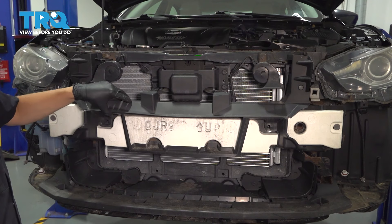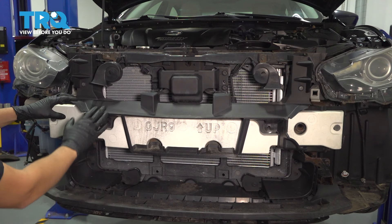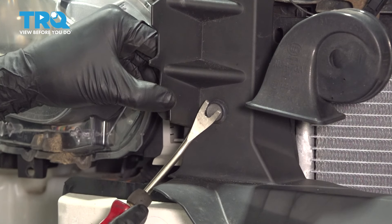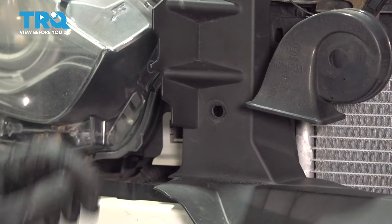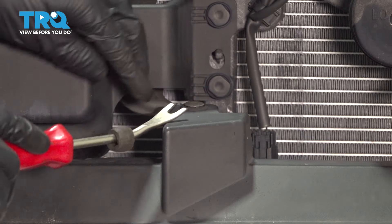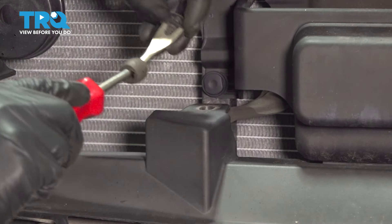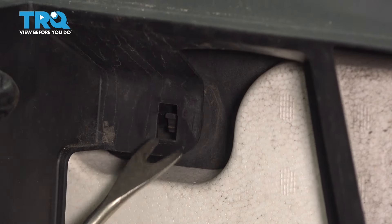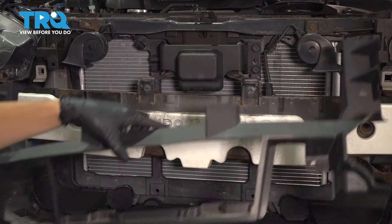Once we're at this point, we're going to have to remove this entire plastic piece here to free up the styrofoam, but also obviously the impact absorber — this kind of goes up and around it. On each side at the top, next to each horn, you'll see that it has a push clip — use a trim tool and pop this out. This should free up the top. Same on the other side. Towards the center, you'll see another set of two push clips, one on each side. With that removed, all that's holding this piece on is these little clips that you have to pry up on and pull out — it's kind of like a little locking tab, one on each side. With that out, you can remove this piece.